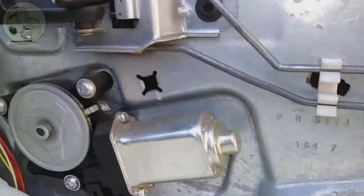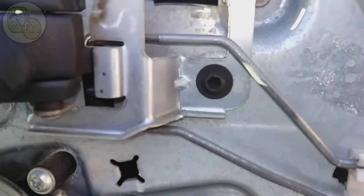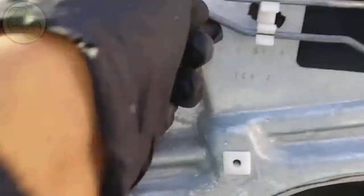Here is where it broke, right up in there. If you can see, there's a break in there — you see this clip piece. This is the piece that when you pull on that handle is supposed to make the door pop open, but it's not connected anymore because it's broken. The lock is working but when you pull on the handle it's not doing the same function. I can move it manually with my hand — that's what's supposed to happen when you pull the latch. That's where the actual piece broke from.